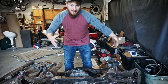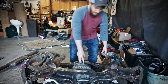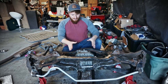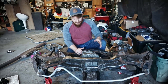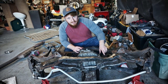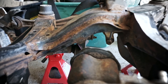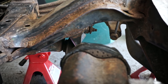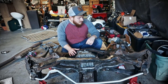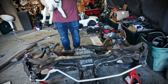You want the axles not poking out unevenly, and height is going to be whatever works best for clearance. I've got everything clearanced for the axles to be able to move in, out, up, and down as needed. Side to side is the big thing I'm working with - specifically where the CV cups have potential to contact these supports in the crossmember down here on the underside. I think I'm in a good place though; I should only have minimal trimming that I can reinforce when I'm done. Now I just need to buy some metal so I can actually start fabbing it up.